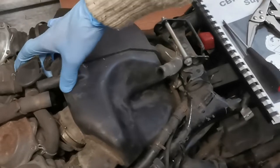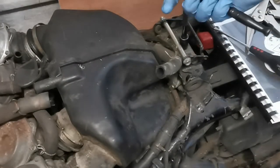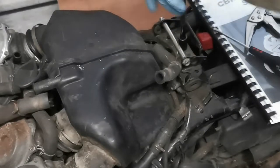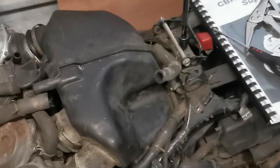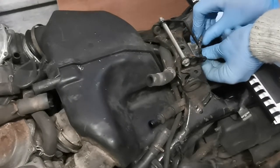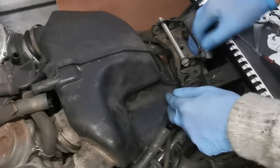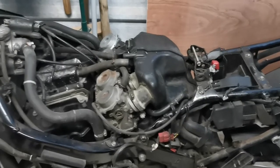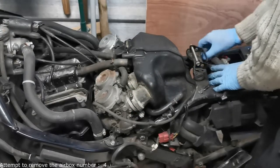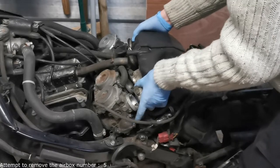Safety goggles are going back on just because I don't want petrol in my eyes — and this is actually the main feed that's causing the leak in the first place. I have to say, even these tubes I'm impressed they haven't perished or lost their elasticity — it'd be a pain if they were just splitting and cracking all over the place. I don't know if it's a natural rubber they used back then. Okay, same on the far side — no petrol in that one. I've taken the fuel pipes off each side and drained the juice out. I've tried a bit of maneuvering but can't get it out — I'm figuring it's this bracket that's stopping it retracting fully. That bracket holds the fuel pump in place and is held by one 10mm bolt. We'll loosen this off without rounding it.